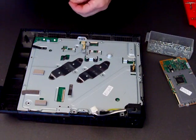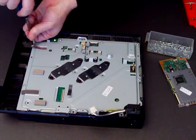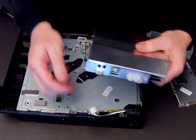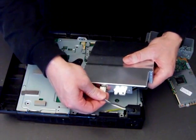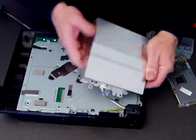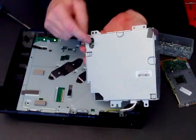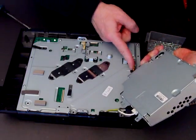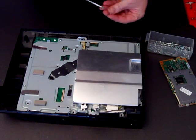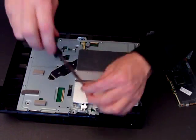Okay, one last one over here. Now we need to put the power supply unit back in. Clip it in and make sure that the earth wire goes underneath this little lug, and then that socket lines up. Put the little plug in, put it on, and just screw it back in again. For the sake of speed I'll not put all the screws back in, just a couple.